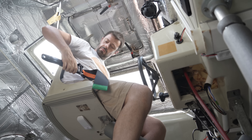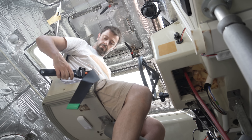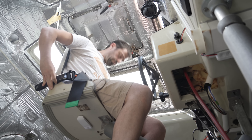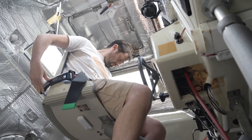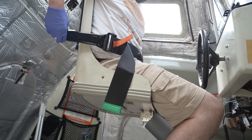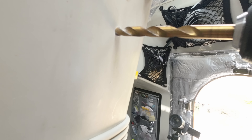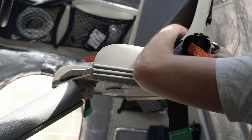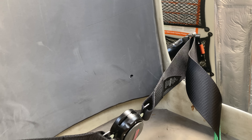I'm going to start with the lap belt part of the harness. Immediately it became clear that I couldn't reuse the holes from the old harness anchors as they were much, much shorter. The two lower anchor points will need to locate rearward and behind the moulding if I'm not going to start butchering the rather excellent and robust pre-drilled, sheathed metal anchor plate. I marked where the holes will need to be drilled, making sure the height is correct so it sits around my upper waist. We're not mucking around, so I've selected 10mm bolts as they won't jiggle around inside the harness's pre-drilled holes, and solid stainless extra-wide washers either side of course.